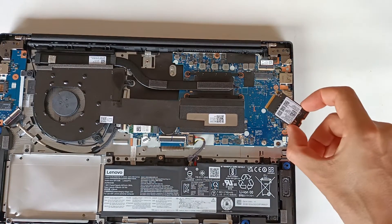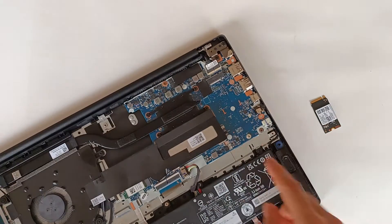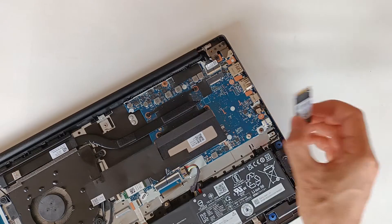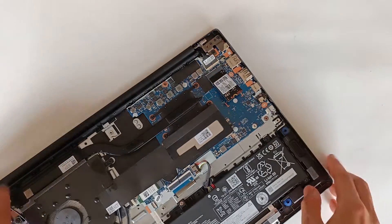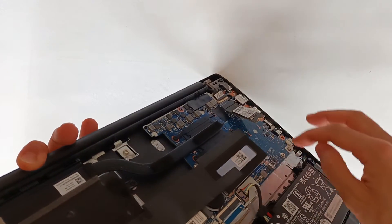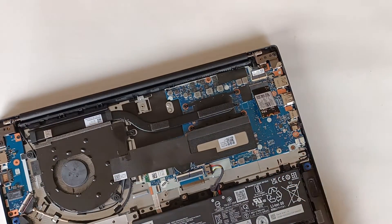I have here a 42mm drive to install. This motherboard doesn't have a place for the middle screw, so if I try to install this 2242 format with 42mm I have no way to hold it to the motherboard — there's no hole for the screw. We can see that this module is tilted because it doesn't have the screw.